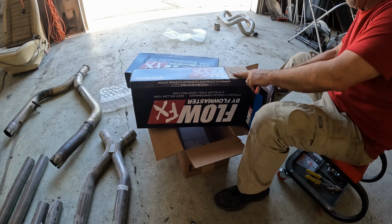Before I cut this pipe and bring it closer this way, I'm going to go ahead and get my front muffler pipe set. I got my little bend piece tacked in, and you can see from the back, it doesn't bend much, but it's just enough. A straight pipe just wasn't going to quite cut it. I needed to move the muffler just a little bit.